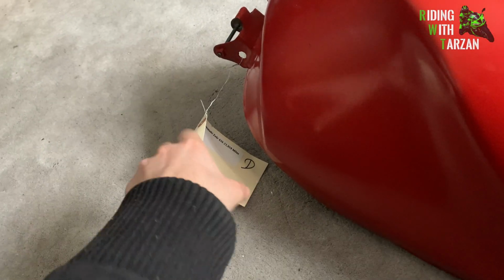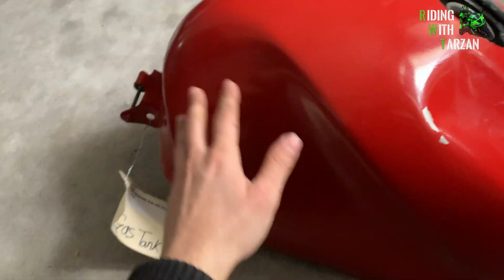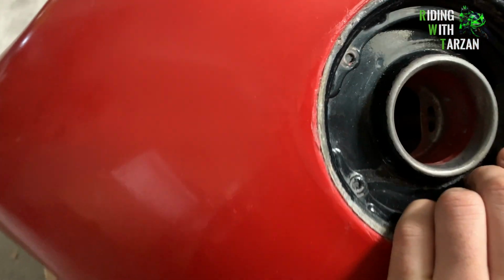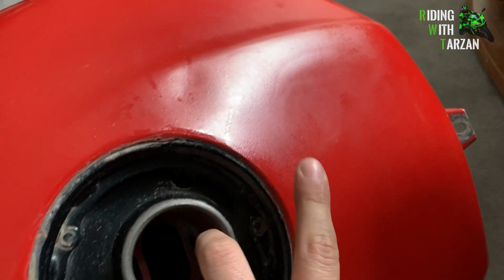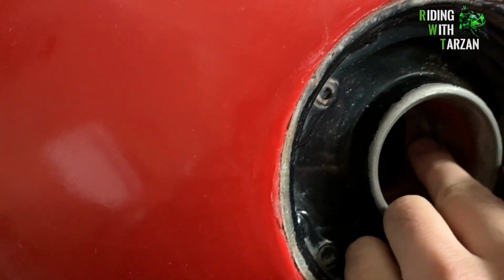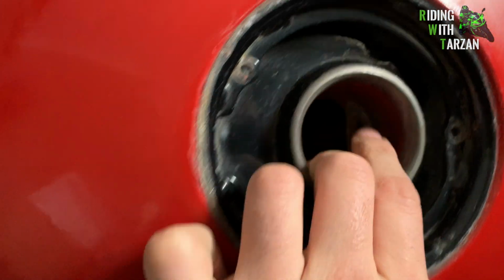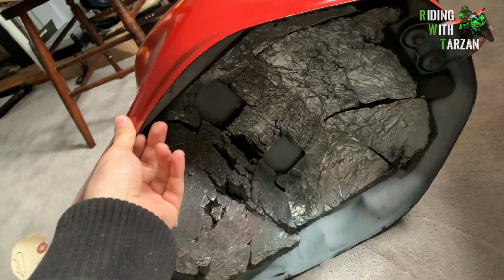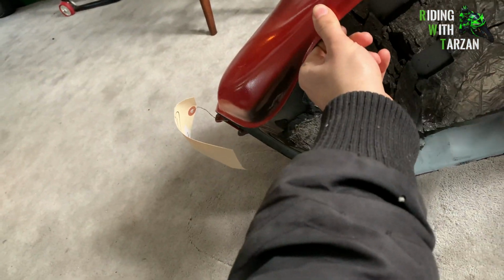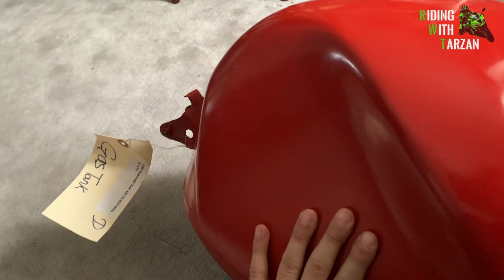When purchasing a fuel tank, one of the things you absolutely have to look out for is that there's no rust inside the tank. In this case, that is not rust, that's actually paint. It looks like the paint from the person trying to paint the outside exterior rubbed off in the interior as well. Now, why don't you want rust inside of the gas tank? Because if there's a leak, they're a huge pain in the butt to fix. And I mean huge. From hands-on experience, you do not want even the smallest bit of rust in there.